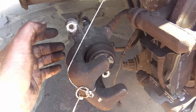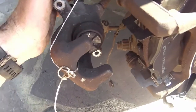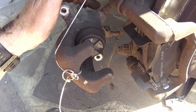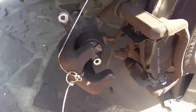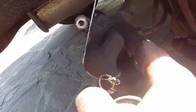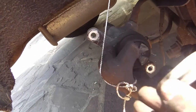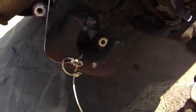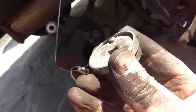The cylinder has a very fine thread on it. I'm not exactly certain how it works inside, but there's a thread in there anyway. It doesn't impede the hydraulic foot brake, but it supports the use of a cable for the handbrake. So this piece fits over. You'll see there are some notches in here, and that's one way of telling that it's present, apart from the fact there's a cable there. On the front brakes there aren't any notches in the ends of the cylinder, they're just flat because they can push straight back, as there's no handbrake on them.